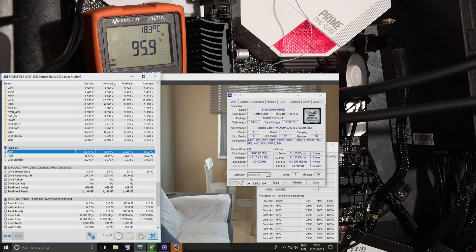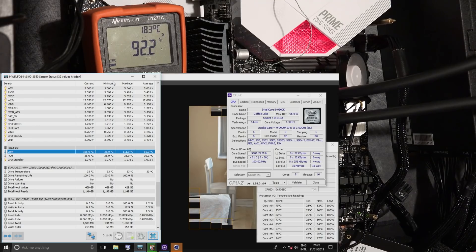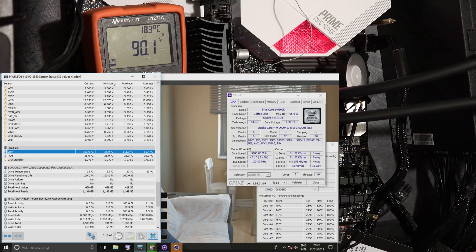This tiny little fan is not going particularly fast and our temperatures are dropping. For Cinebench it should bring us down to like 60 degrees PCB temperature and around 90 MOSFET temperature. When you push airflow through the heatsinks there's actually a bigger gap between PCB/heatsink temperature versus internal MOSFET temperature, because heat transfers much faster out of the heatsink than it does out of the MOSFETs into the heatsink. We're now down from 111 to 103 and temperatures keep dropping.